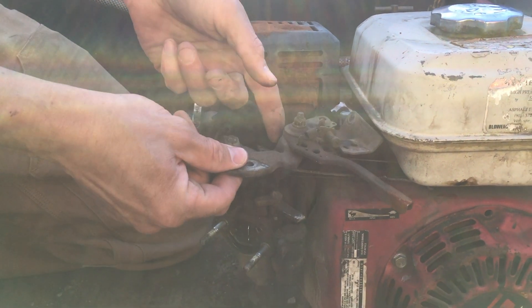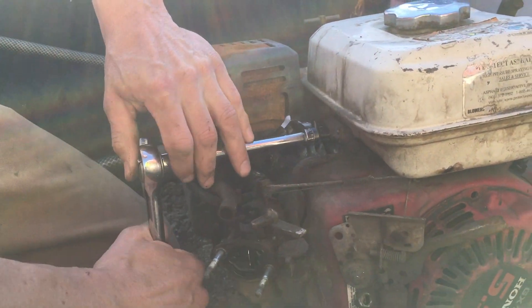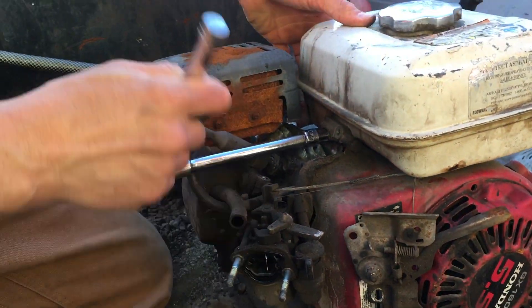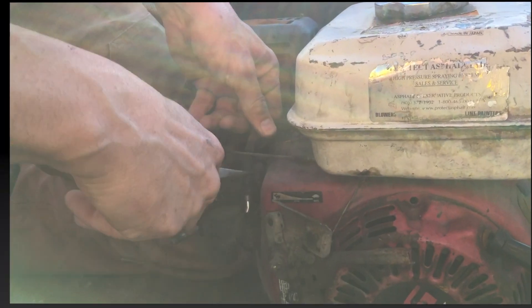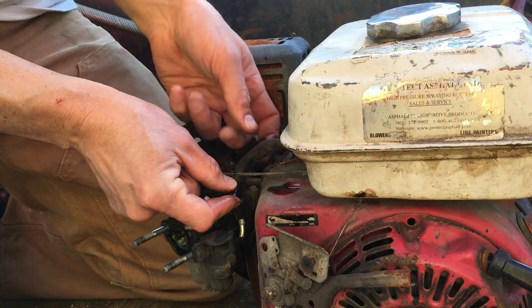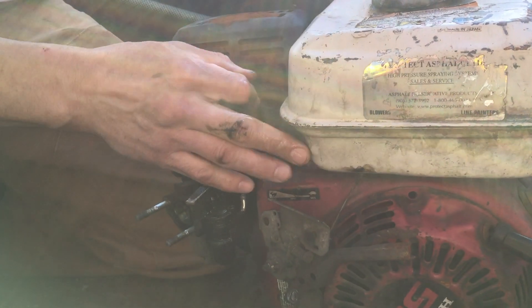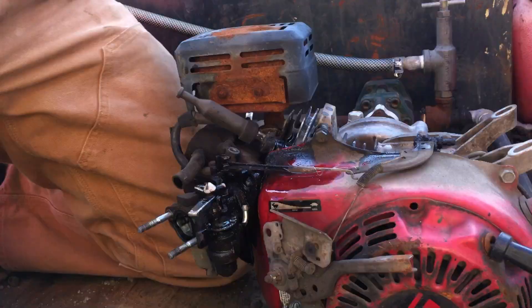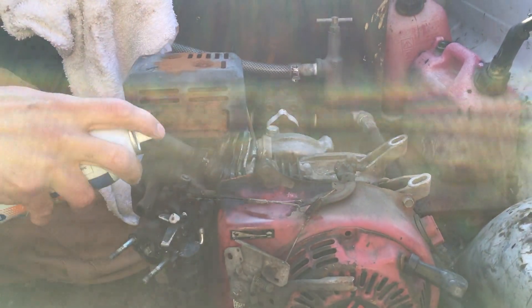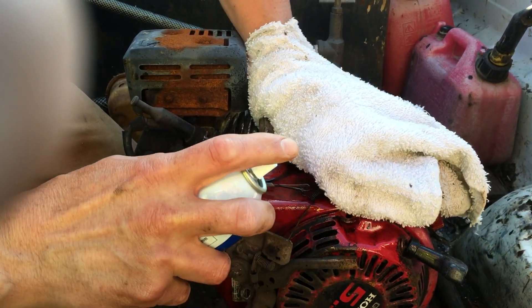Okay, so this is free and of course there's still some attachment here. We just wanted to get that out of the way and get access to this here — it's the remaining bolt for the gas tank. And of course there is gas in it, so it's going to be leaking gas. I'm just going to use some brake cleaner to clean off the area. Since it's exposed, I want it nice and clean, and then I'll lubricate up the joints with some WD-40 after. It's pretty dirty.